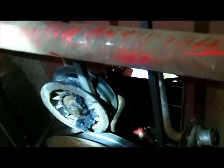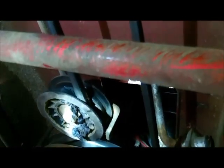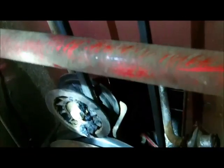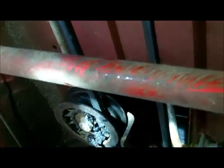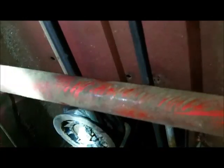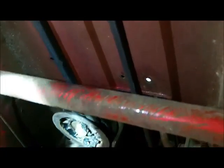Here it is, this idler wheel here. It's called the backside idler, and this is the clutch, so to speak. They call it a clutch in the manual, so that's what I'm going to call it. I know it's not an actual clutch, but it acts as one. And I'm sorry, I can't hold a light and do that too. I'm going to move the clutch pedal. Watch the idler. See it?